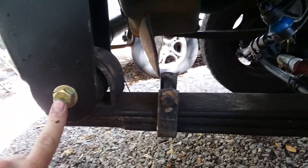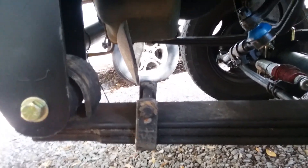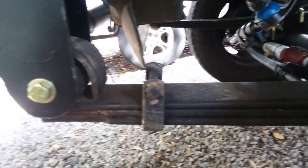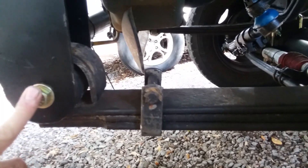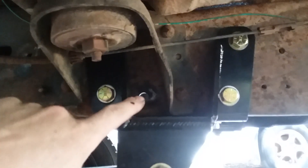When you're doing the rear mount back there — I'll show it to you in a second — you're gonna measure center hole to center hole. I was told everything from 51 and a half, 52, 54 and a half. I measured and it was 52 inches from center of this hole to center of this hole.